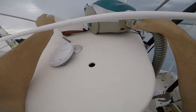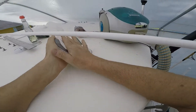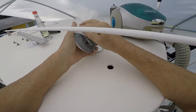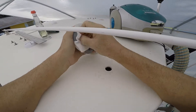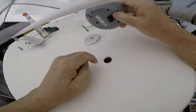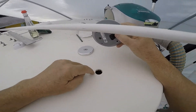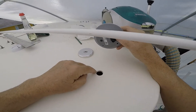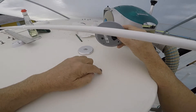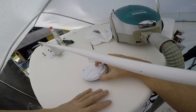We got our hole drilled here. I used the wood bit for drilling wood. When you drill fiberglass, I always run the drill bit in reverse to start off — that will prevent you from getting cracks or chipping the outer coat. I'm going to bevel this with a file in a minute, put a bevel on it, which also prevents spider cracks. So this is where the compass is going to go.